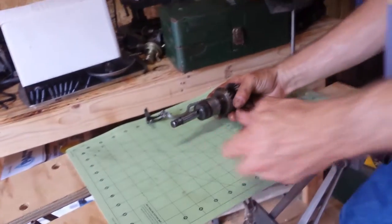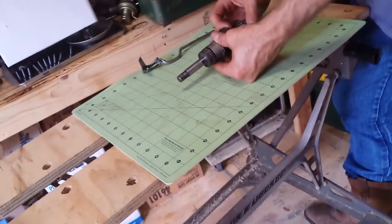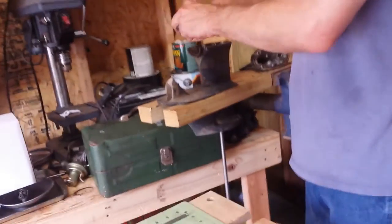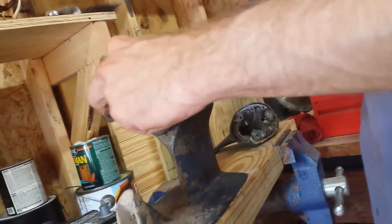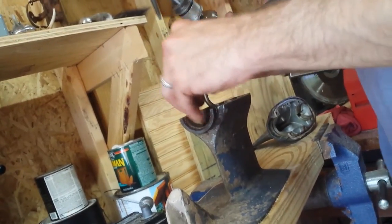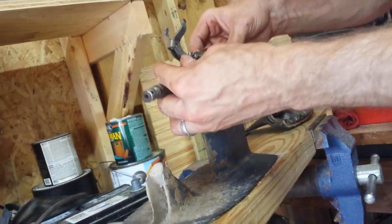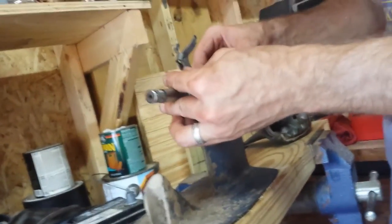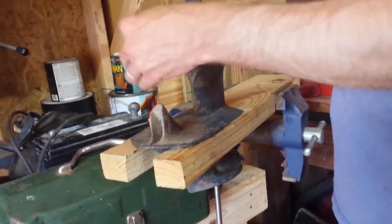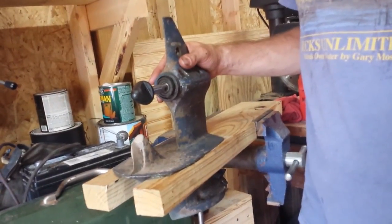Some designs are different — they have different bearing designs and different use of washers. But with that knowledge you should be able to figure it out for the model that you have. I'll go ahead and put this back together starting with the shift rod, which has a curve to keep things out of the way. There's a slot in the forward gear that joins with the guide pin. That concludes this video — if you like what you saw, subscribe to Highland Outboards and let us know what you think.